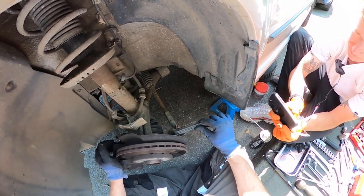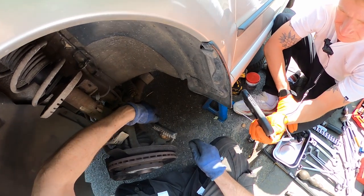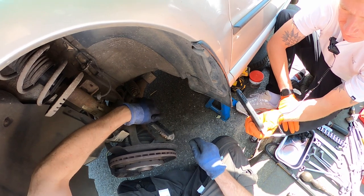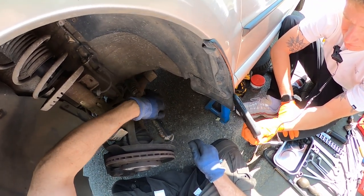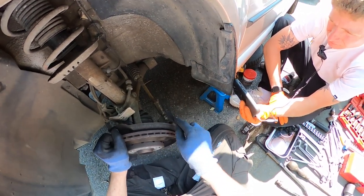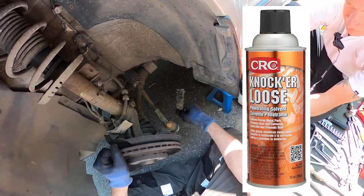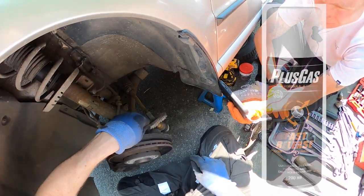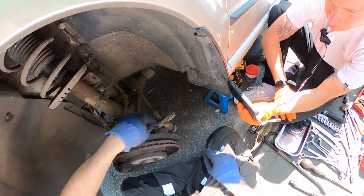Penetrating oil acts with a capillary action, which means it will suck itself along any tiny little fissure it can find to get into the groove. The molecules in penetrating oil are much smaller than lubricating oil, so it will go into the smallest of crevices even on very tight bolts. There is a penetrating oil called Knocker Loose which apparently has a special formulation that works especially well - it's very expensive. Personally I'm not sure it's worth it, so I'm happy to use Plus Gas, which is much more reasonably priced. I'll put links to both in the description.